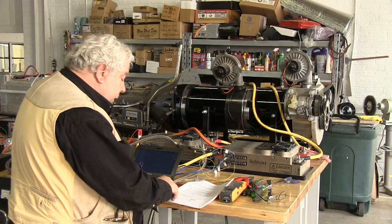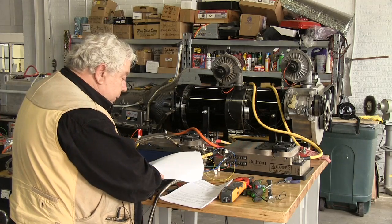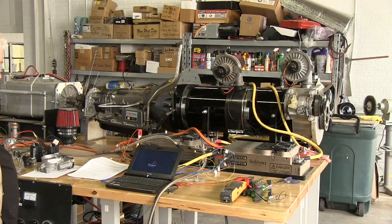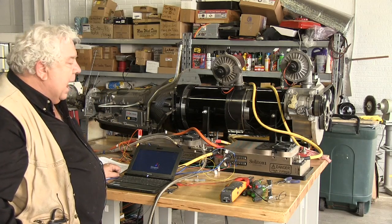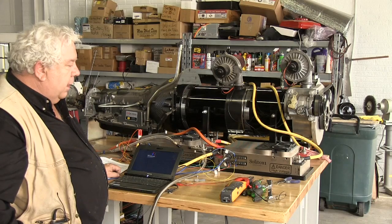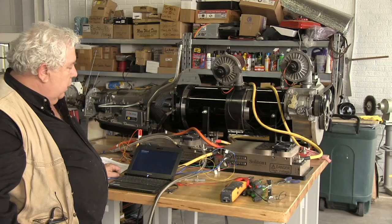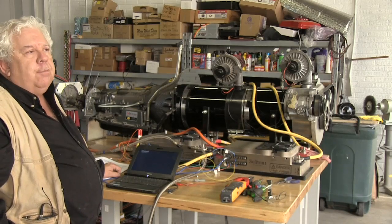You know, the most interesting one in some ways is the start input. We have a start button here. And that allows your Soliton 1, as long as it has a tachometer input, to act a little bit like starting an internal combustion engine with an automatic transmission. It will ramp up to idle RPMs and then maintain that from there on. We have the manual for version 1.4, and we did the 1.5.1 upgrade.